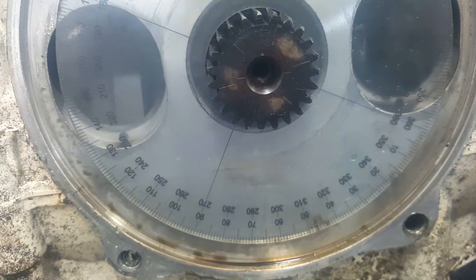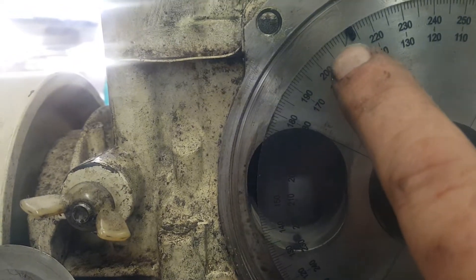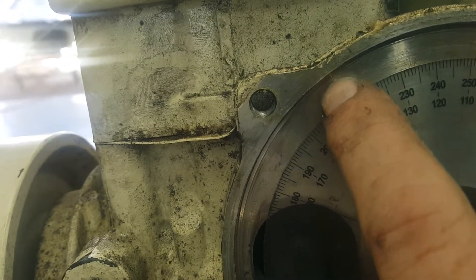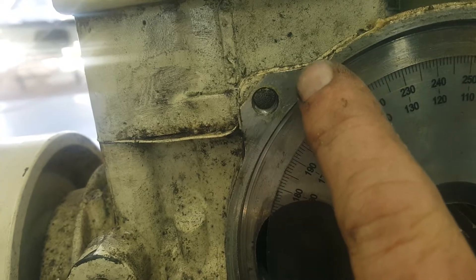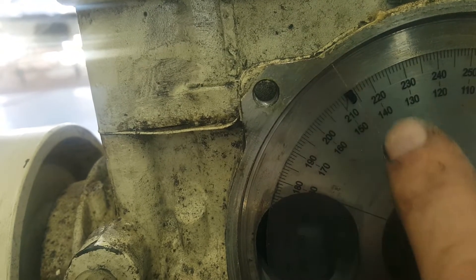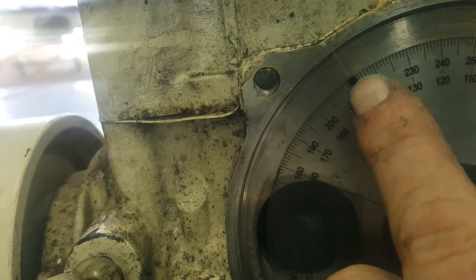You can see that's lined right up and it gives you a reference line, which makes it easier — some engines have it, some don't. Then mark 147 up here. You can see somebody has already scribed it into this aluminum — do not do that, it damages the surface. Mark it on your wheel and then mark it on this outside edge where the cover goes. Don't mark it in here.